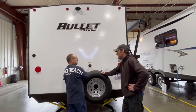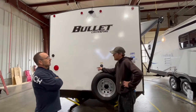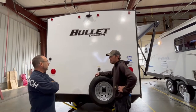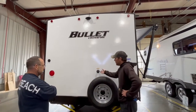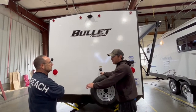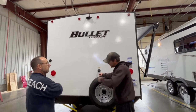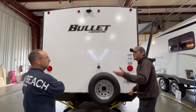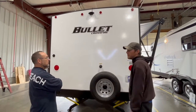When you use that, I'll tell you this: when you turn your water on, don't forget about it, because you'll fill up your tank. Usually when you're flushing this, I tell people to keep the black tank knife valve open. If you want to close it for a couple of seconds you can — close and pray — but just don't forget about it. Put a timer on your iPhone for one minute. You've got a panel in there that tells you if it's a third or two thirds.